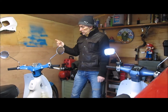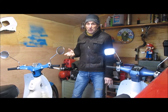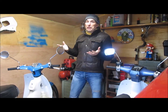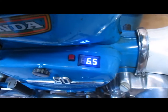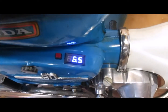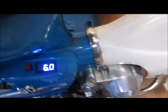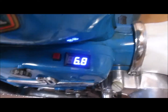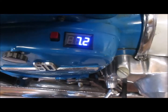Going back to the pilot light and how it affects the charging system on the bike — the best way to look at that is by looking at the battery itself, because it's the battery that tells us the story. As you can see, I've got a little voltmeter attached directly to the battery and it's reading 6.5 volts, which shows that this battery is in good fettle. When I switch the engine on and rev it, the voltage has gone from 6.5 to just over seven volts on tick over, showing that the battery is being charged up on tick over.